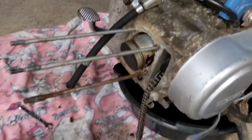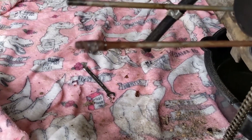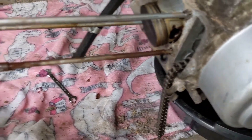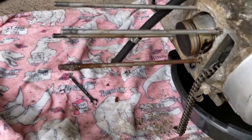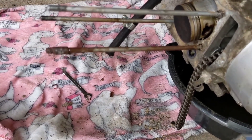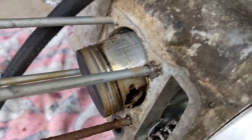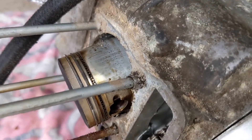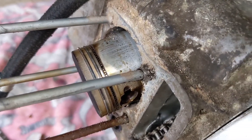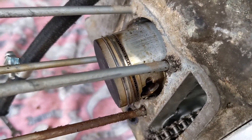Got in a bit further now. This took so long to come off — look at the state of it. All this brown was in there; I think something like water has got in, because it's a kind of brown sludgy rust sitting in there, so I need to do something about that. That's the piston itself. I'm not sure the piston rings are sealing much — they look like they're just flush with the piston, so the rings must be worn out. There are two more at the top, but all of them presumably need replacing.